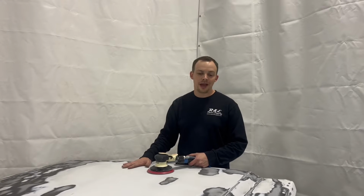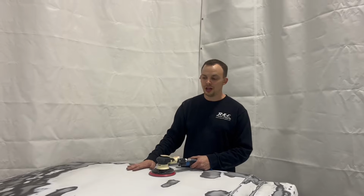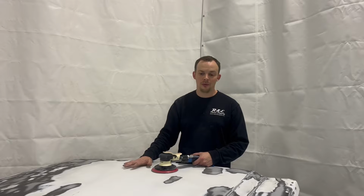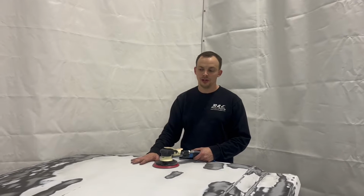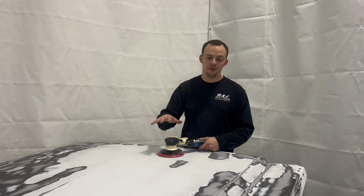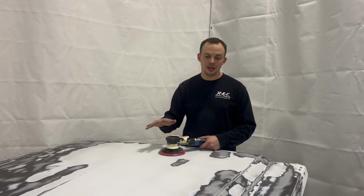If yours is not as bad as this one, you can probably start out with 180 grit to start removing the clear coat. Also, prior to that, we actually took a high-powered power washer to this, knocked all the loose clear coat we could off, and then took compressed air and blew it off as well. Anything you've got to do to get most of the clear off.